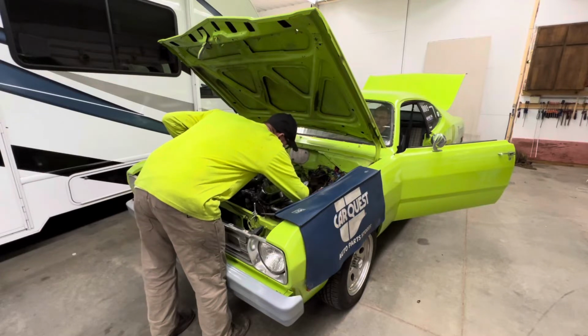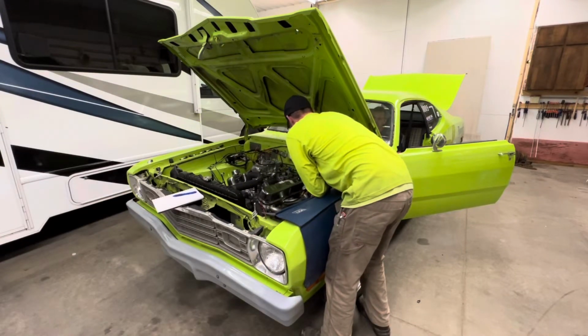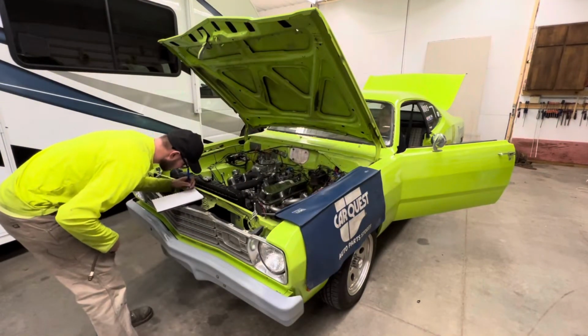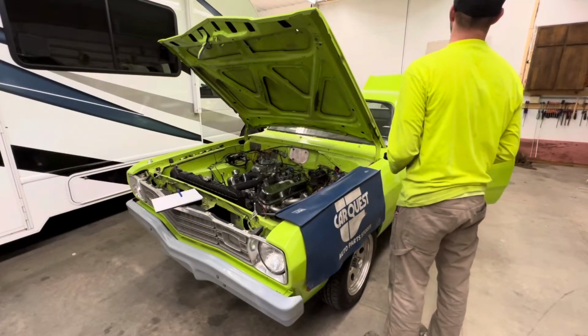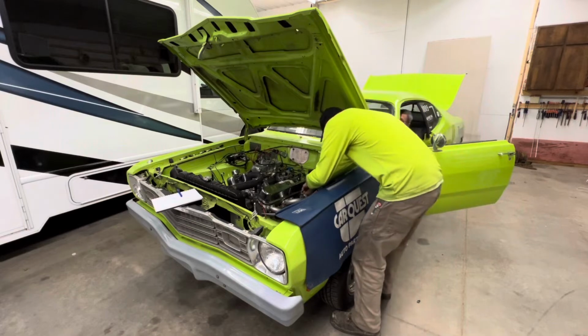Looks to be about 160. Really? That low? Okay. Cylinder 3. After 5 it's 165. Why so low? I don't know. Well, the cam was advanced. It was a smaller cam that was advanced last time. So we get more with a smaller cam? Yeah, you'll have more cranking compression with the smaller cam, especially when the timing is advanced. We're just looking for consistency. It runs good, so.